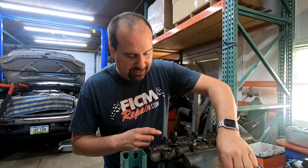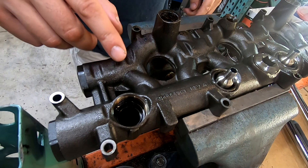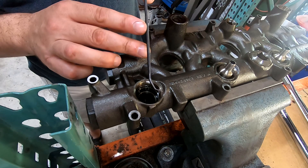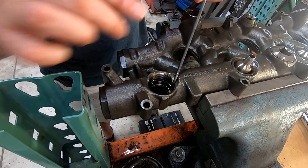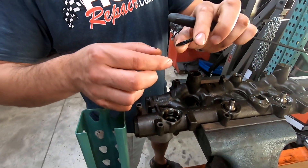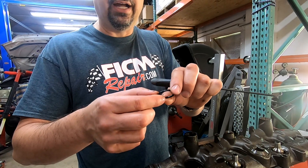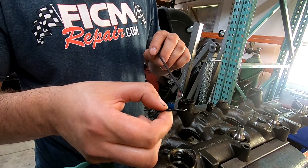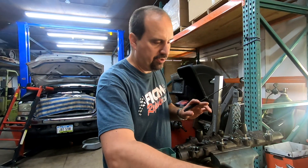Take this one off. I'm going to have my cameraman shine down in there — you'll see there's an O-ring inside. We want to fish that out. Take our little pick and go in there. There it is. He's stiff — stiff, stiff. He's not even maintaining a circular shape. You can see one edge is oblong from where I pushed. He's hard and tired — that's not what you want.